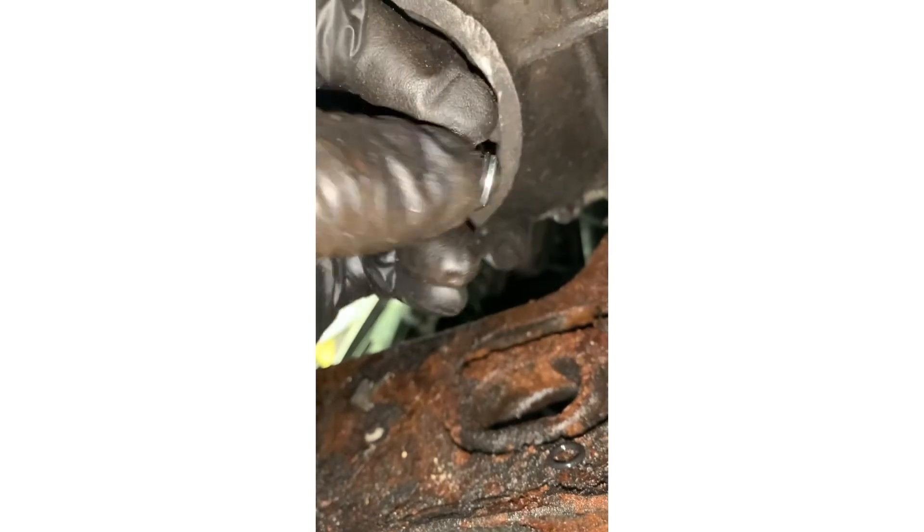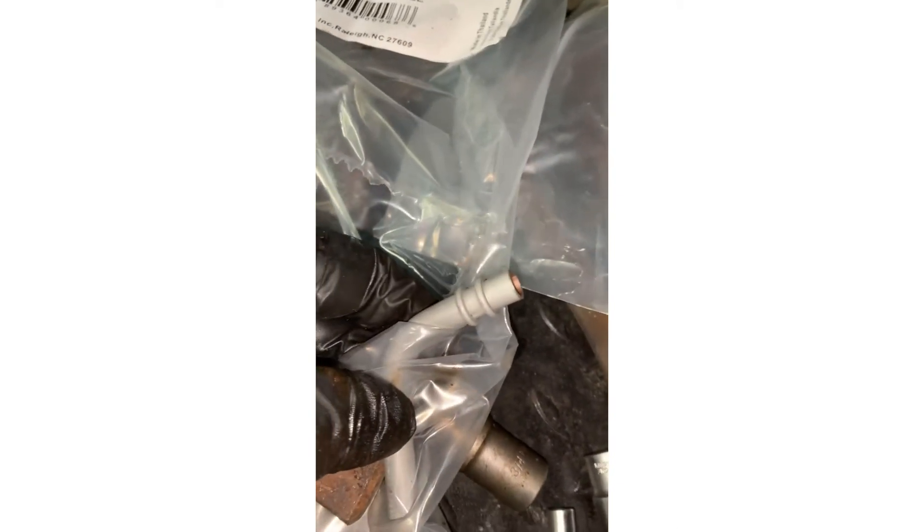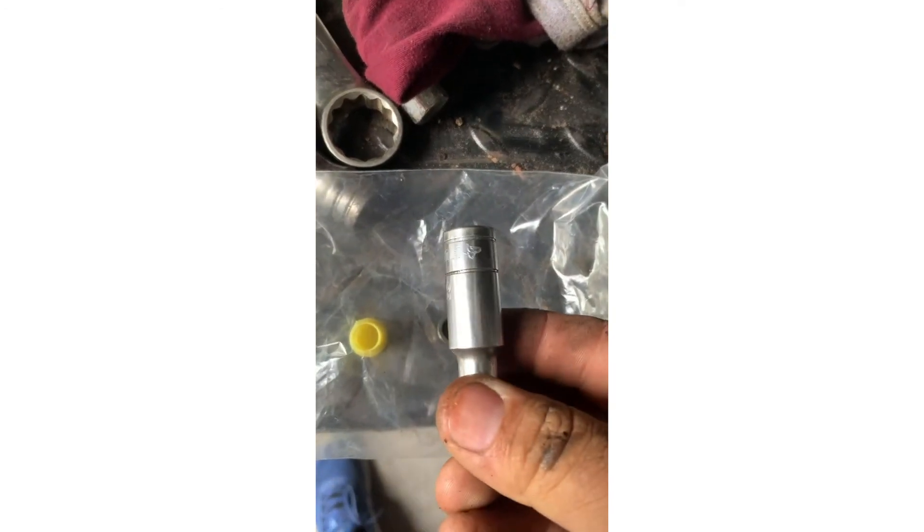What you do with the new hose is put the O-ring on it. You put the seal in the upper, and then the other holes are the same style — it goes right in there. I'll show you now. What I normally do is put the seal in the upper. I have an 8mm long socket. I push that in with my finger and then put that over it in the hole. You tap it real slow — you just want it in a little bit. You don't want to smash it too hard.